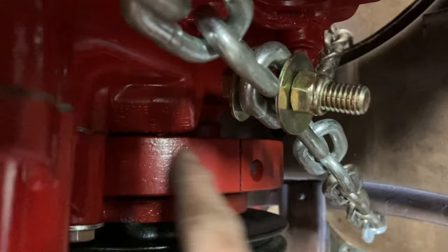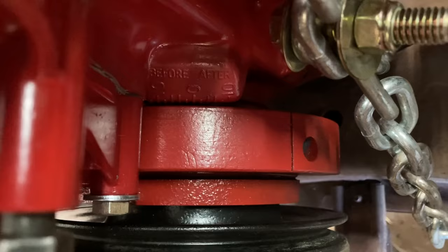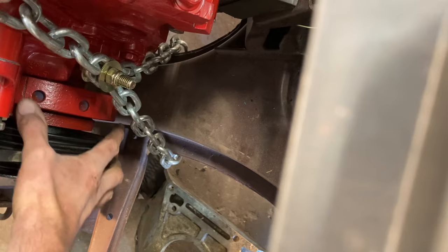Right there — we stop exactly right there, don't do anything. My timing mark is past the zero, so I'm going to back that timing mark up to the 10. I know this distributor has only 10 degrees of advance built in, so I will back this up to the 10 — that is before the zero — and I'm going to lock the distributor down. I'll show you that process: back it to the 10, right there.